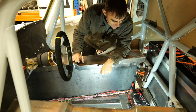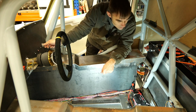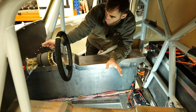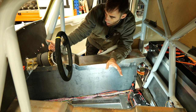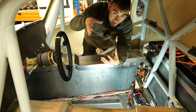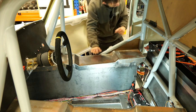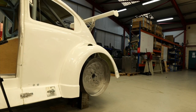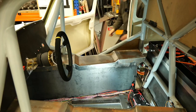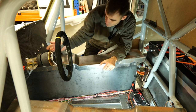First thing I'm going to check is the EPB - the electric parking brake system - just working off the 12 volt ignition. If I twist this now we should hear the motors on the rear calipers tighten up. Ready, go. Oh, that worked! Happy days. I've got a light on the dash which confirms the clamping force is up to where it needs to be. I'm just going to go and make sure the wheels don't spin. Success. So parking brake works.